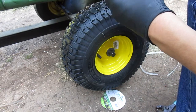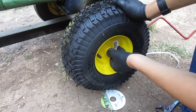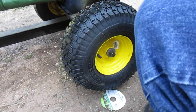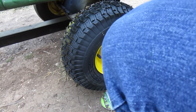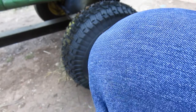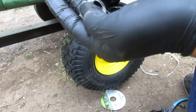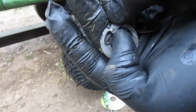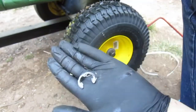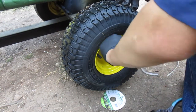They give you a new pin as well, and this is just a big spacer. I'm going to go ahead and put that new clip in - the old one is actually kind of reamed out just a little bit. This is the old one and there's a little bit of rub right in there - that's no good. This pin has always been loose, so I'm just going to slide the new one in.